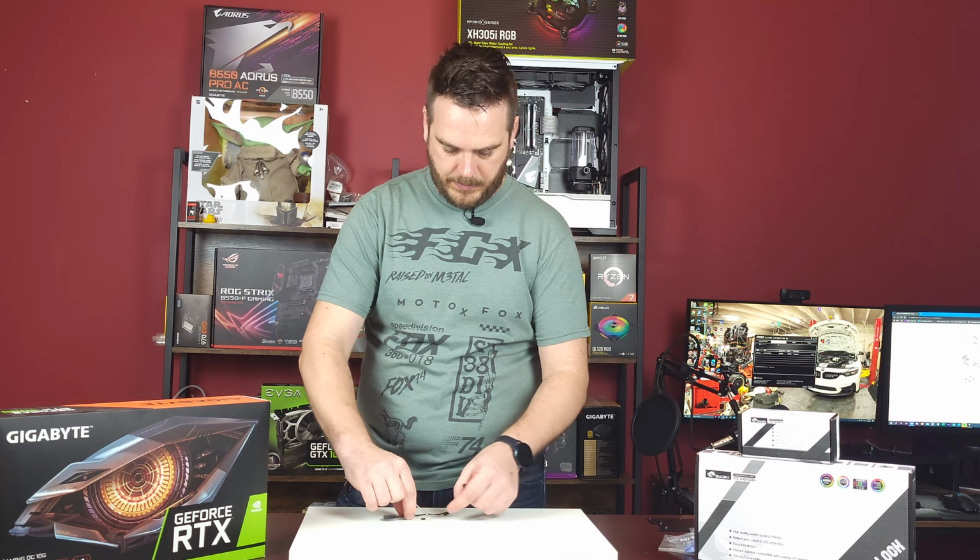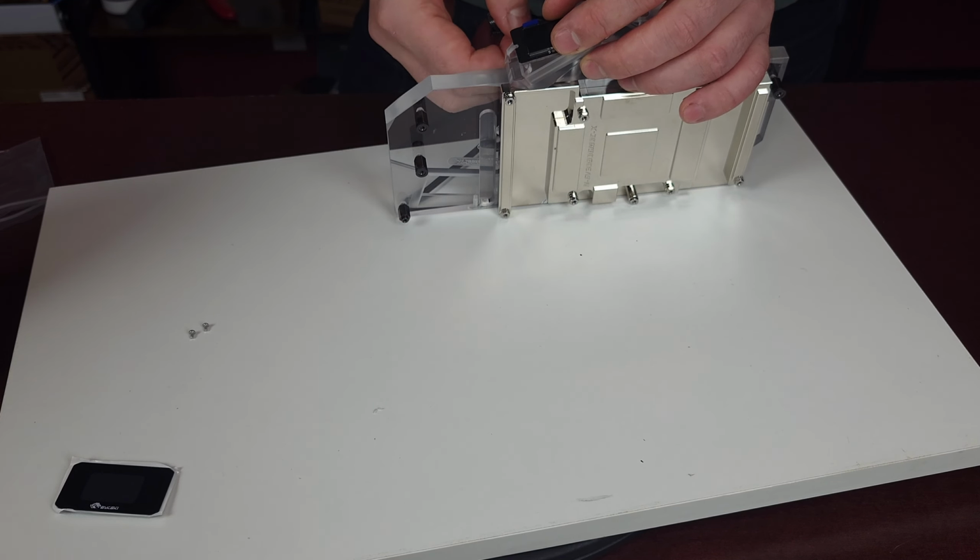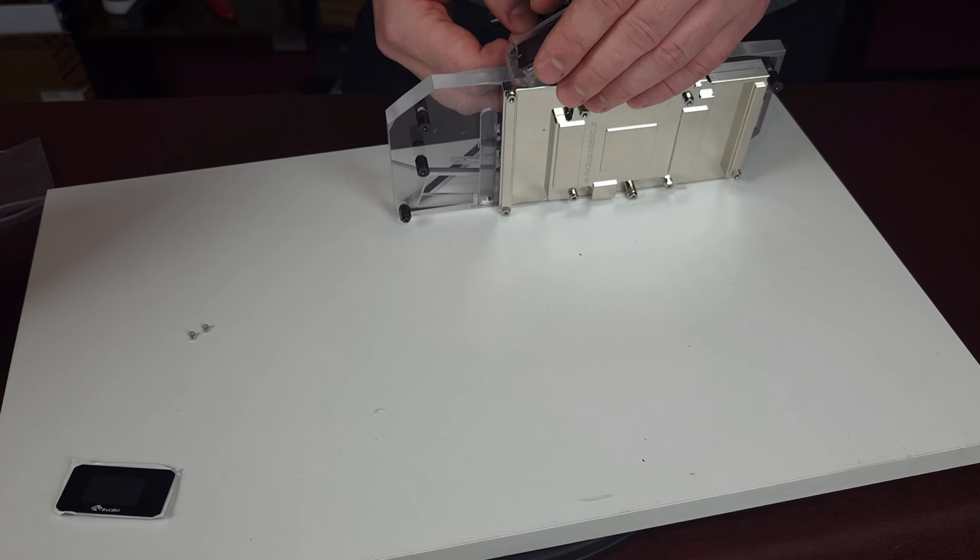So where is this? There's a cable that we need to install it to. So the screen uses a Molex cable. So we gotta install that because it's gonna go inside the casing. So I'm gonna push it up first, install the screen on it so it clicks in properly, and then I'll install the sensor inside the screw. Let me give a little slack. Let me give a little slack to this too. Goes into sensor, goes in, pull from the cord. So it makes it nice.